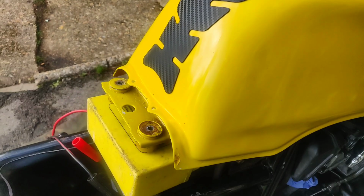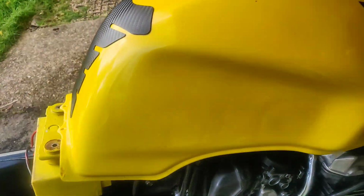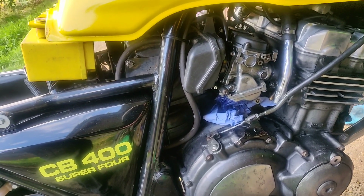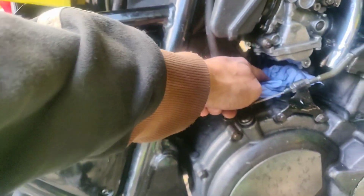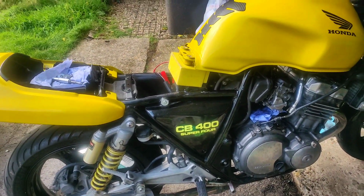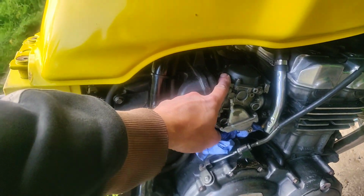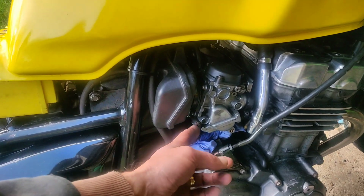And also, we're back in. Now there is a slight issue with this, and is it going to do it again? And we have a Niagara Falls situation of fuel because the freaking carb's leaking again. Right, so we've got noise, it runs, all four are hot, and it's pissing fuel, and it's out the join between carb 3 and carb 4. So where I put the grommets in to do it before, it's just not holding it, which is a proper pisser.